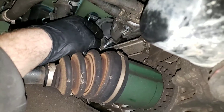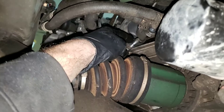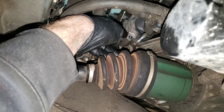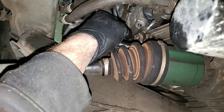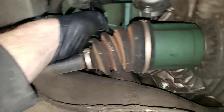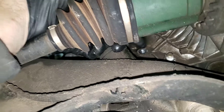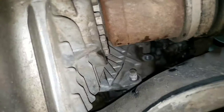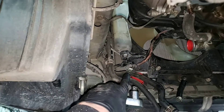Don't forget the bottom starter bolt — it's a stud that's a 14. Behind that, a lot of people forget there's another 14 screw that holds the transmission to the motor. Right under that there's another 14, and if you snake under here and look, there's this 14 and then the nutted 14 that sits on this one — that's the same on both sides.